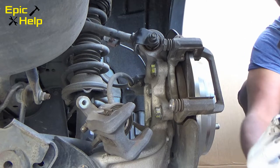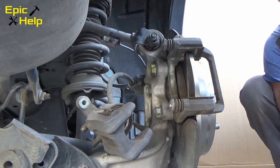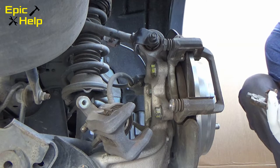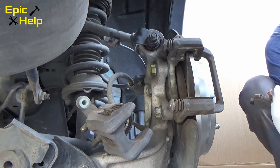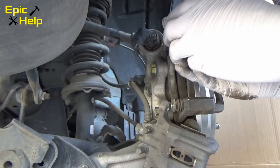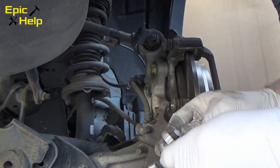Compare your old and new brake pads to know which ones go on the wheel you are working on. On this brake pad there are 3 prongs on the back. You might want to bend them a little bit before pushing them into the piston.